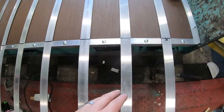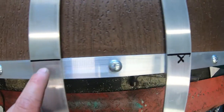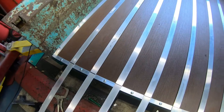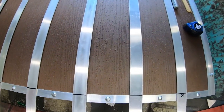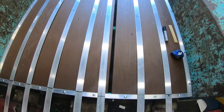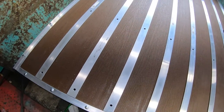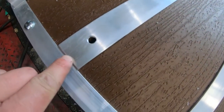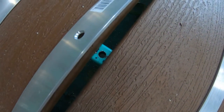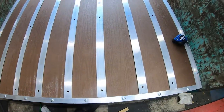Now it's time for the bed strips. The strips are a little long - I picked these up from Lowe's and marked exactly where they need to be. They're a little bit over what they need to be because I'm going to use a sander and sand them down so they don't have any gaps. I'll go ahead and cut these - I've already drilled the holes in my supports. That'll help to hold the wood, and there'll be a hole every other center section. I've just finished up cutting all my strips, cut them exactly perfect with the line, and drilled and chamfered all my holes. All of my holes are now drilled for my strips of aluminum.